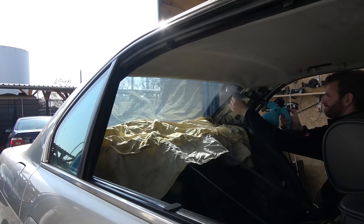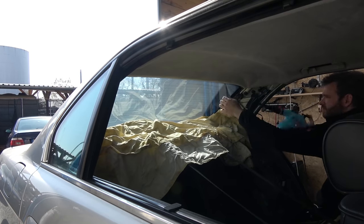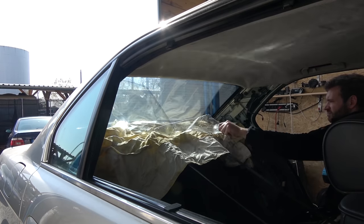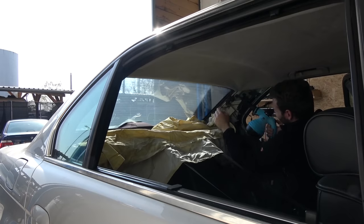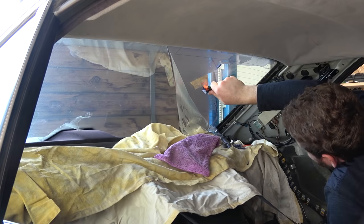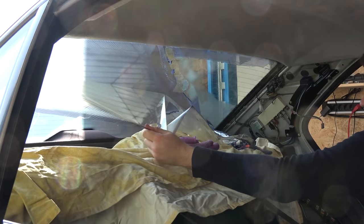I complained in part one that there was like a paint fumey smell inside the car. Turns out it was the rear tint all this time. It was too layered. The first one came off easily, but the one underneath put up a fight. Steam was doing nothing, so I resorted to shouting and a scraper to remove the old glue, which only took me half a day to do. Only two defroster lines were exposed on the surface of the glass, so I had to be careful around them. The rest were inside the glass, which made things a bit easier.